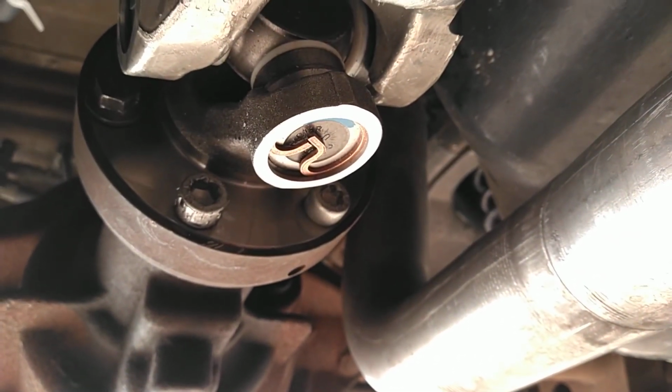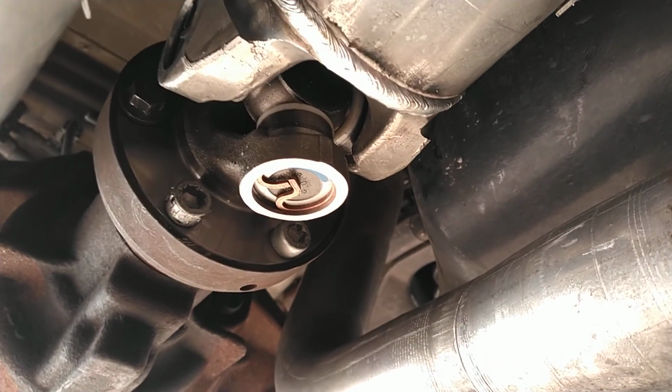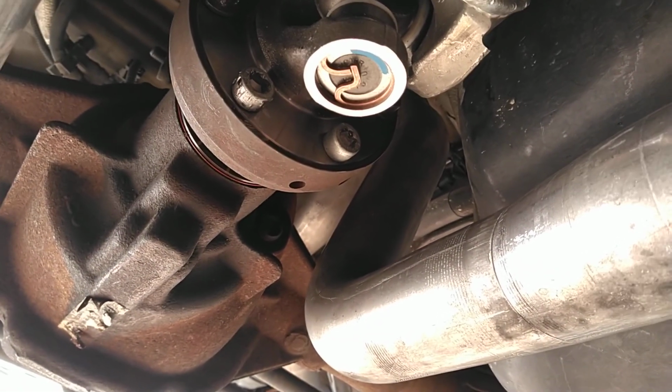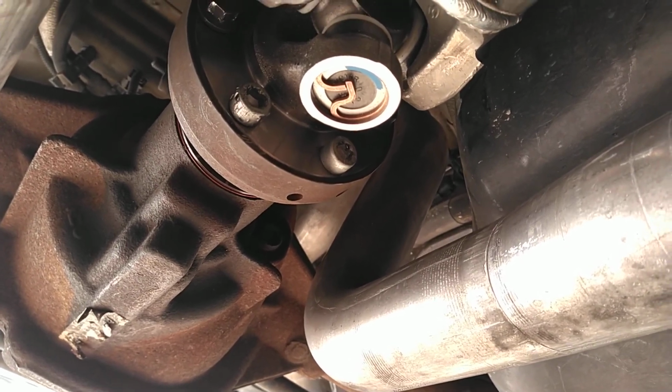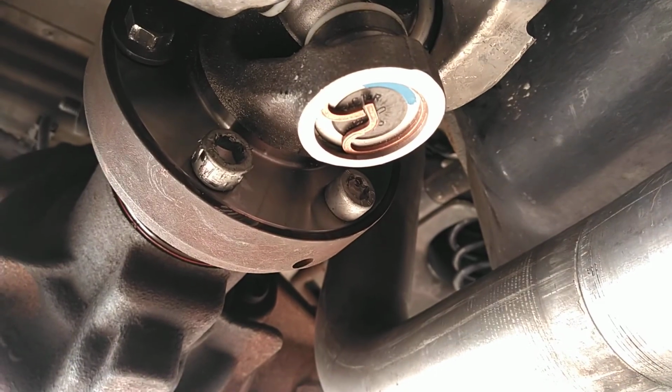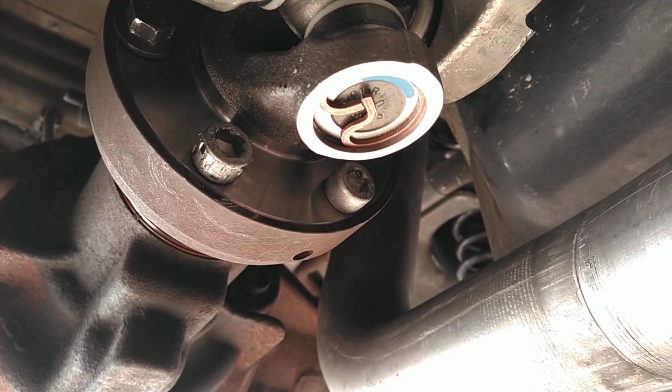All these bolts have Loctite on them. When you get them, they're the new bolts that come with the kit. If you notice, there's going to be 2 hex bolts like this. There's also one right there. Well, you have to use those as the alignment bolts. So you have 2 6-point. Those are both 13s. You'll need an open end wrench. You cannot get a socket on there at all. These are a 5/16 or an 8mm Allen.